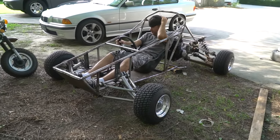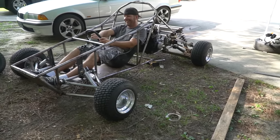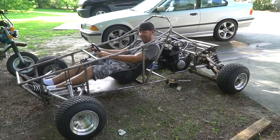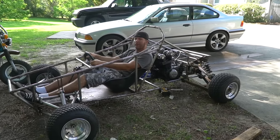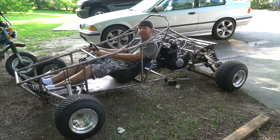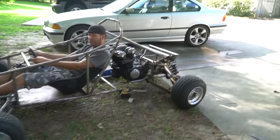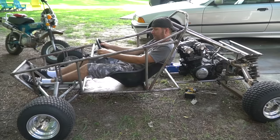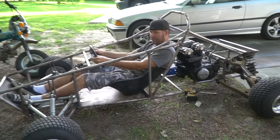Right after Ike's first crash, it's ready to go. We were just talking — the weight distribution is not going to be that bad on the rear. It might be 55/45 or 60/40. I'd say 60/40, because the engine is in front of the rear axle a decent amount, and the rider is kind of in the middle slash forward, so we have good potential here for weight distribution.